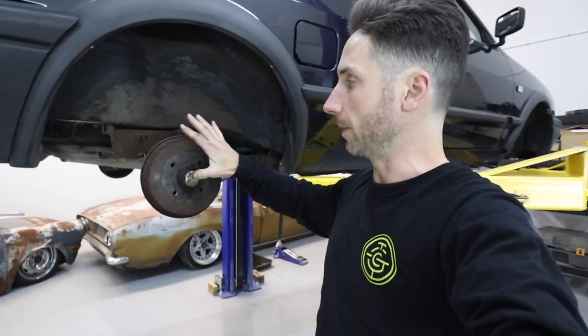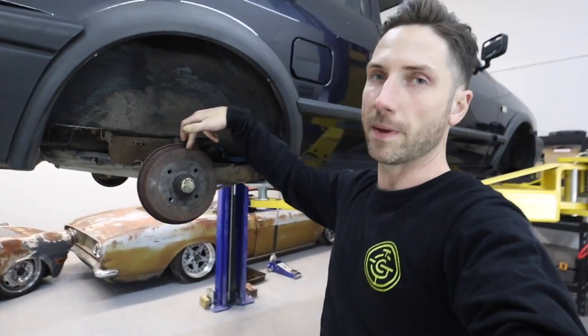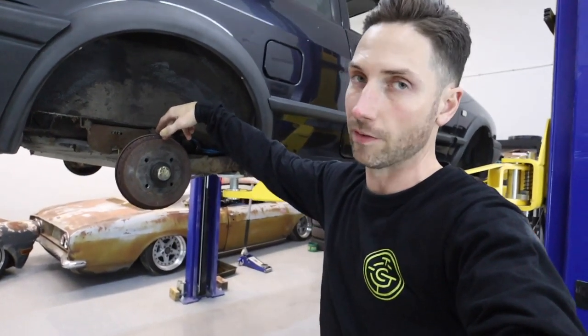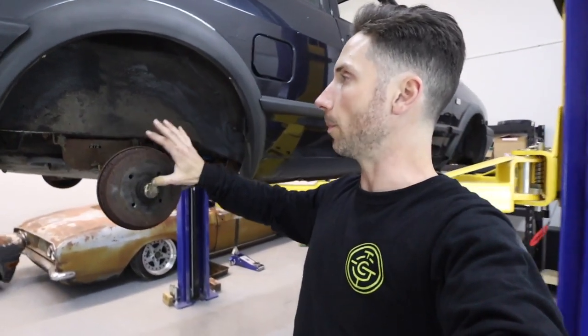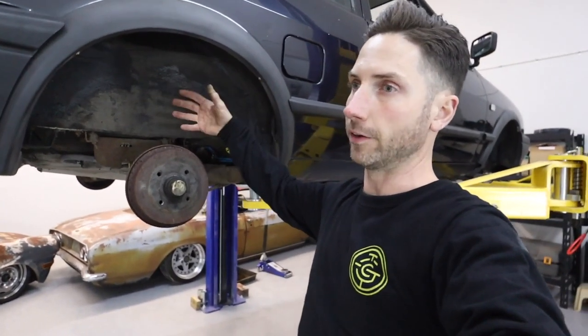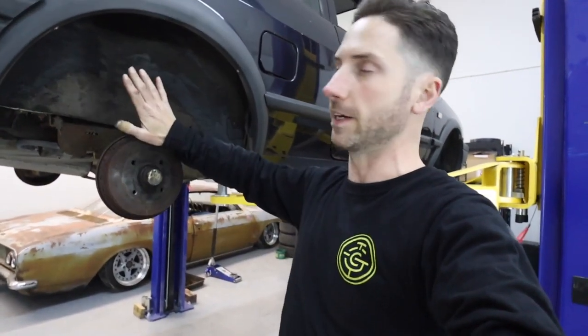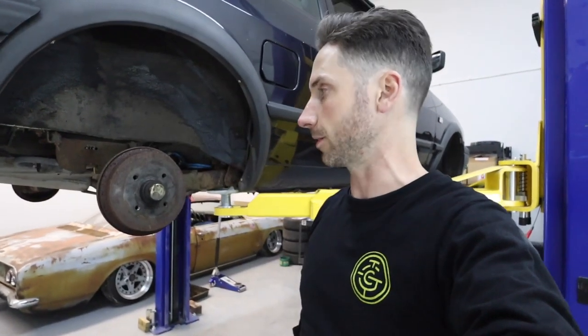And my plan is, I haven't gotten too far into telling you guys the full plan, but I plan on making 3 to 3.5 inch drop plates for the rear, which I made for my Fox wagon back about 11 or 12 years ago. So I'll be able to relax the suspension and drive at a better either coil rate or PSI while I'm driving super low. So I'll get an immediate drop. It's like running a drop spindle basically.